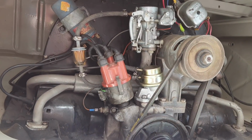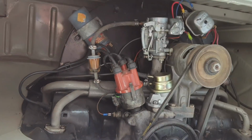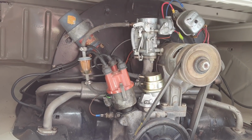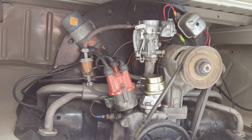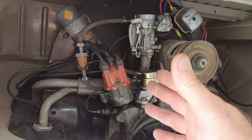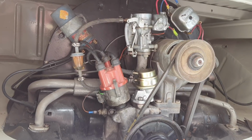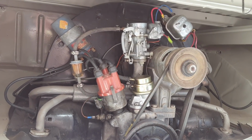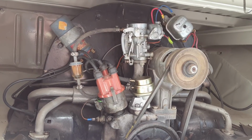If it stinks really bad, a terrible smell, you can replicate that. Let's say you don't know what that smells like: just take one of your spark plug wires off and run the engine with it off. It'll tell you what hydrocarbons smell like. That's a misfire you're smelling. It's the same smell when your points are really going bad and it's misfiring a lot. If you get behind your car and it's spitting and sputtering and you can smell that, that's hydrocarbons. That's what a lean misfire is.